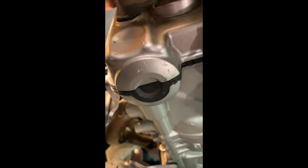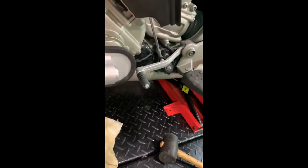Putting the cylinder head valve cover back on again and tightening those down to spec. Then I'll put my new spark plugs in — they're sitting over there — and put the coils in. I've also got to take that filter off and change the filter too, so I still have quite a few things to do.